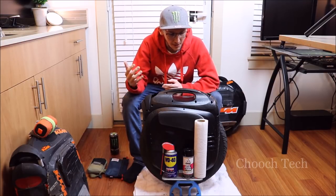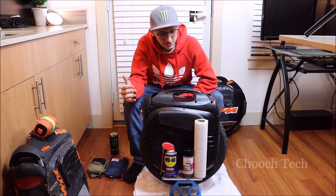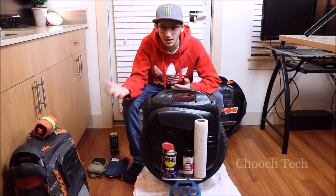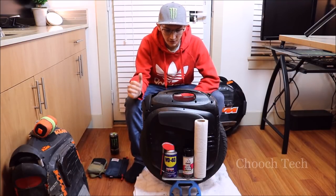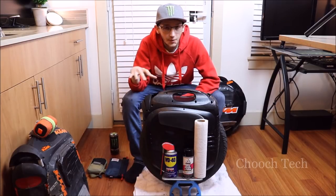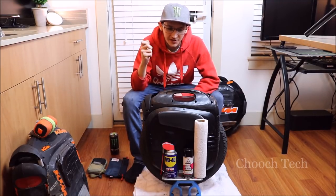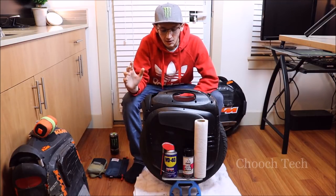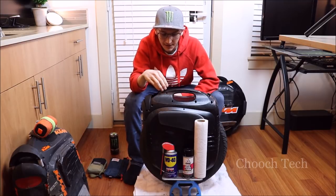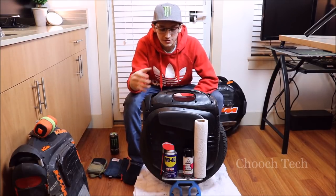Maintenance is really easy on these things — you don't have to do too much. A lot of guys like taking them apart and doing different stuff, but I like keeping it simple and doing the bare minimum until I absolutely break it. I live out here in Denver, Colorado. We just had a good snow and they put salt down everywhere, plus this new liquid-type salt that's sticky and makes a mess all over the wheels. Over time your axle will actually start to rust, and that's one of the weakest points riding in the snow or rainy weather, especially when there's salt on the road. This will help you guys that live on the coast too.